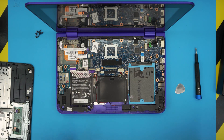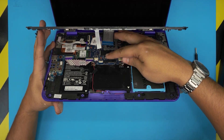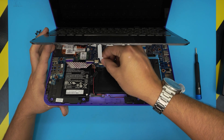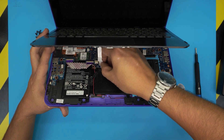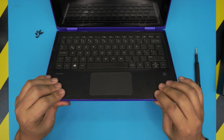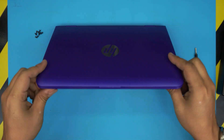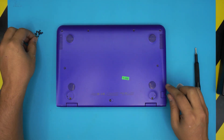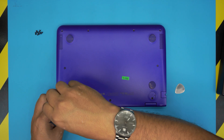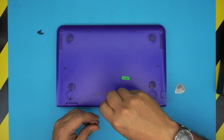Open up the lock, lock it down, and plug in the battery by sliding the connector into the groove and pushing it all the way toward the jack. For the keyboard flex cable, make sure the lock is open, bring it from the back end, slide it all the way in, and lock it down. Same thing for the trackpad — bring it in all the way and lock it down. Then pinch the top and bottom cover firmly and you'll hear the clips snap. Finally, flip it upside down, put the bottom screws back in, and put the cover back on. I hope this video helped — click that like button, leave any questions in the comments, and I'll see you in the next video.